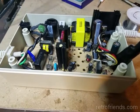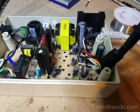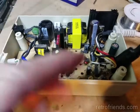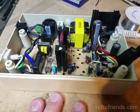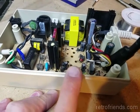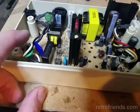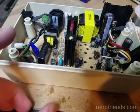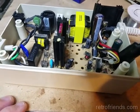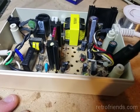What I've discovered is that this thing needs a load in order to perform correctly. When plugged into the Amiga, it's rock solid. I've heard of power supplies that are that way but never had experience repairing one like this. So I don't need to replace any other components — it's functioning correctly. However, since this is from 1994 and I've already ordered the caps, I'll go ahead and replace all of them. The only real problem was the blown MOV, and I've replaced it with a physically larger but electrically equivalent one — the closest I could find since parts from 1994 are hard to come by.